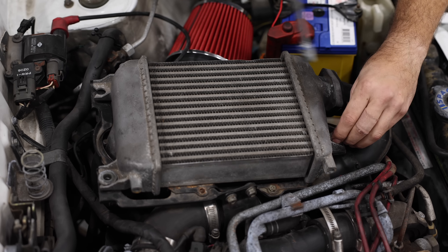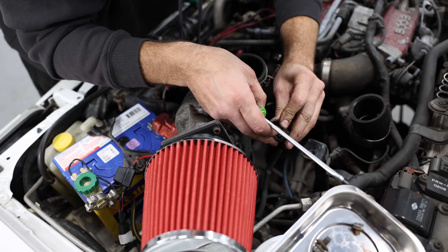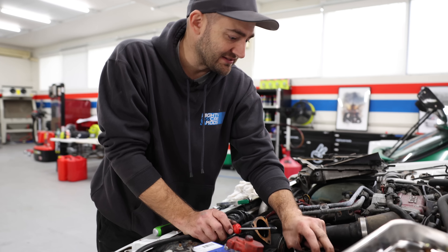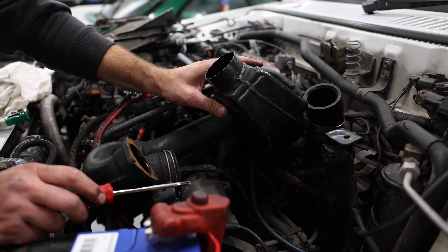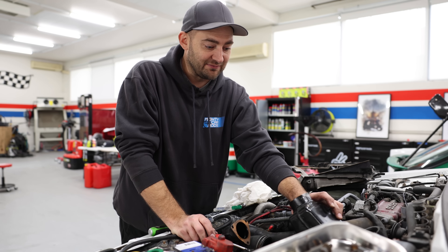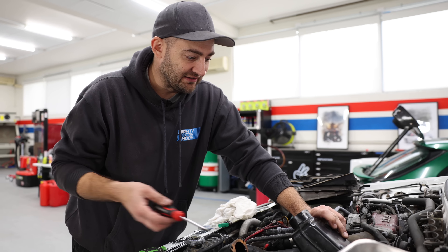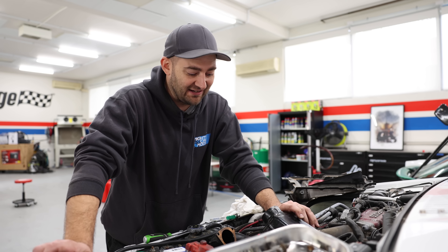It's no good cleaning the fuel tank and changing the fuel pump without also changing the fuel filter, which is the last line of defense against grot before it hits your injectors and then your engine. So I'm going to get the old one out, which involves pulling half the engine bay apart. This thing here is the anti-honk device — there are a couple of vacuum lines coming out of it, so it's kind of important in terms of balancing everything up, but basically it's just there to make it honk less, which I think is offensive and should be removed as soon as humanly possible.